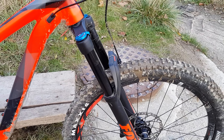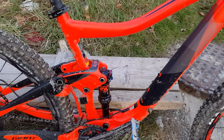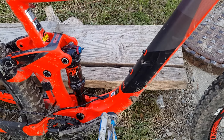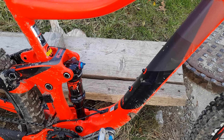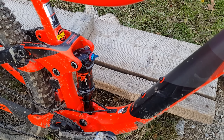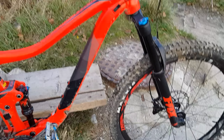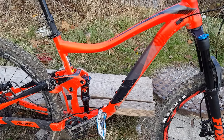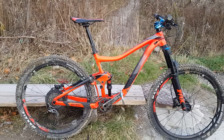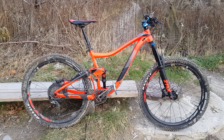For the rear shock, because the mid-stroke was very plush, I have it set to around 228-229 psi with both valves fully open. I went off a few jumps and it felt perfect — didn't feel like it was bottoming out. So there you have it, the 2018 Giant Trance 2. I'll be releasing some new videos soon, so stay tuned. Thanks for watching.